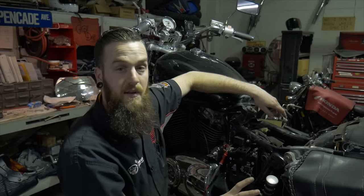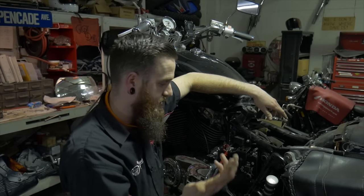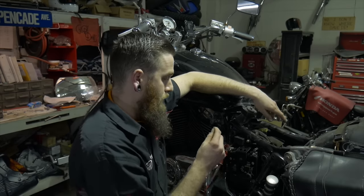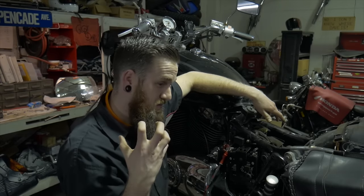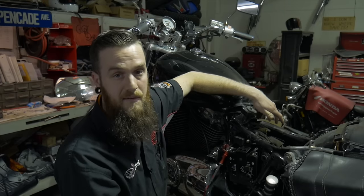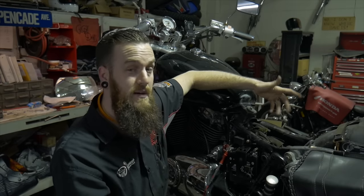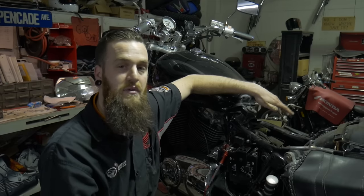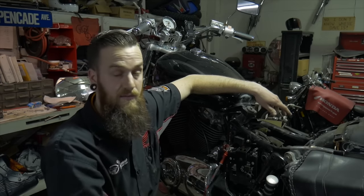Once that connector melts, you can have a charging system issue even though the stator is putting out fine — it's just never reaching the regulator rectifier. With just that one battery check, I've isolated one component of the charging system. This guy was dealing with overcharging the whole time — it's dangerous because batteries can melt, catch fire, or explode. The overcharging burns up the lead cells inside so the battery can no longer hold a charge and acts dead. I'm going to put in a brand new regulator rectifier — it's a combined unit, only 57 bucks.